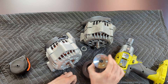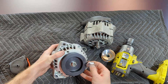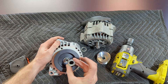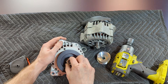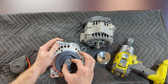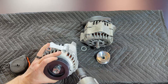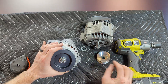That came right off. We'll go ahead and drop the new one on — and look, this one actually fits inside of that one, so it's significantly larger. Put the lock washer back on. I like to use the nut that was on there. I always just tighten it back down so the paint line matches — there's a white dot on both the pulley shaft itself and the nut. Spin it around — the nut from the other one was still on there, so we need to go quite a bit further.